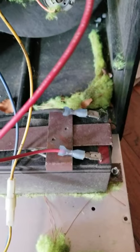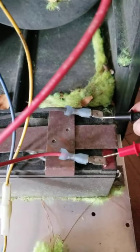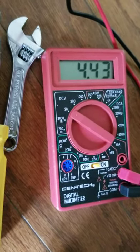These are supposed to be like 12 volts, so they should go up to about 13, or at least 12-something. Let me show you how much it is now — it is only four. So it's a dead battery. You should have at least 12-point-something.